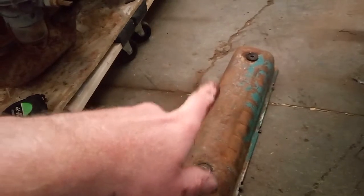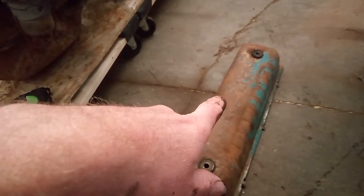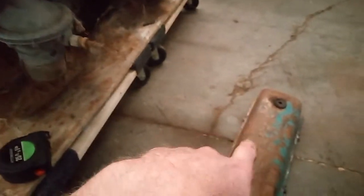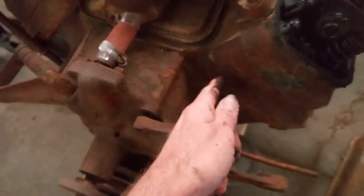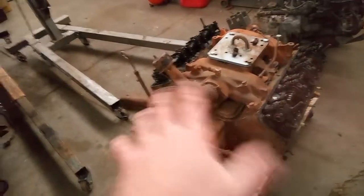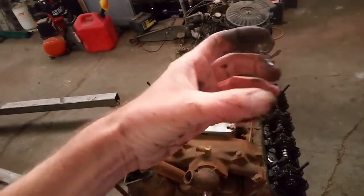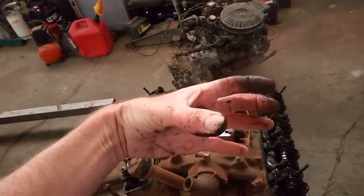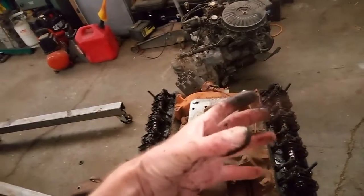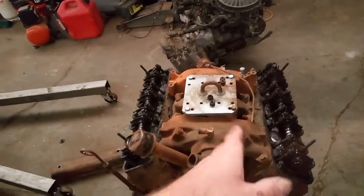I've learned that if you see them on an old engine, be careful of that engine. That's showing that it's got a lot of crankcase pressure. And if it's got a lot of crankcase pressure, more than likely it's got compression going through the rings, and what it actually is is blow by. And blow by is bad news. Anyway, that means that the cylinder walls, something's going on there that it's not sealing. The pistons aren't sealing against the cylinder walls. It could be because the cylinder walls are worn out, or something's going on there. And when it goes on down there, bad things happen to the pocketbook when you try to fix it.